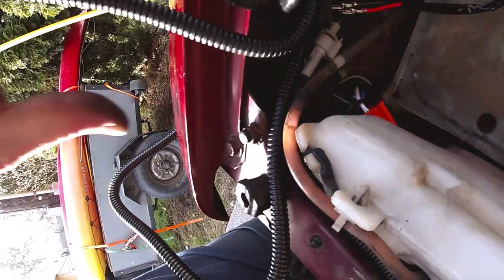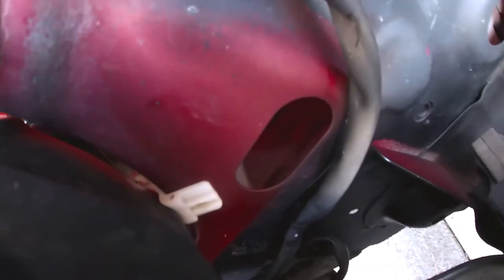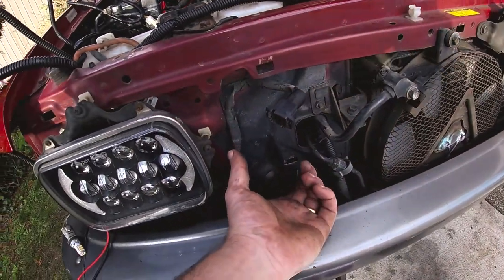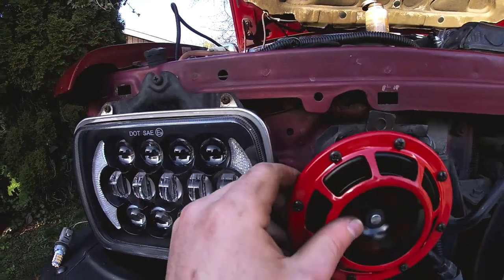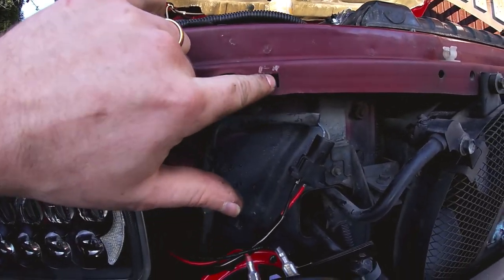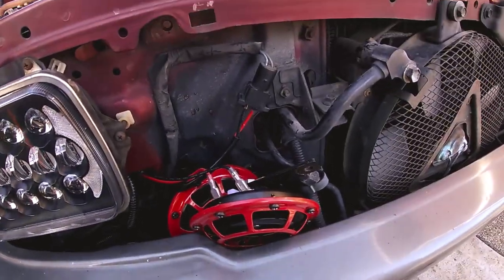The plan is to run all three wires - the one that connects to the stock horn wire - behind the washer fluid reservoir. This is the connection to the passenger side headlight, running around in front and out this hole to connect to the two horns. We're going to mount them here, using this old hole for the horn that has the shorter cable, keeping in mind not to block off the area with protrusions in the grill.